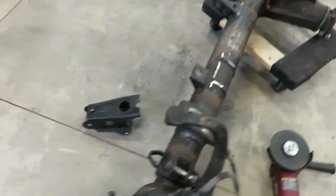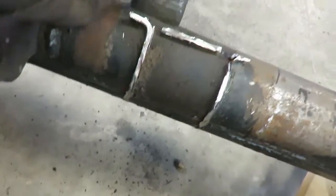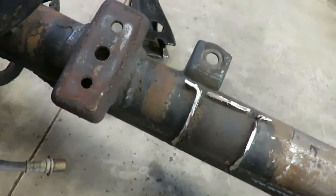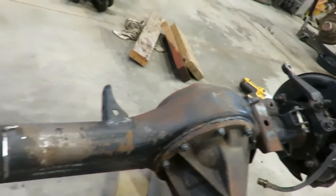Well, there's that. Let's go around and do that to both sway bar mounts — that one, that one — and the steering stabilizer. Cut those off, and then we'll get a grinding disc and grind all the rest off, get it all smoothed out. Pretty simple stuff.